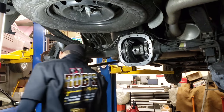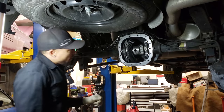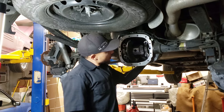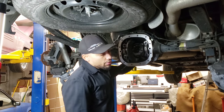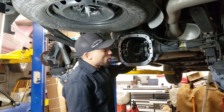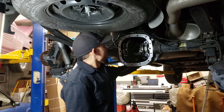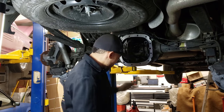So before we started out with 12, we had 11 and a half. That half, that's not gonna affect anything. Pretty sure if I was to do a pattern check, again, sometimes when you have gears that are ran already, it may look a little goofy if you was to try to check that, but for the most part, we're within specs. This thing will go down the road, no noises, and we're good to go.